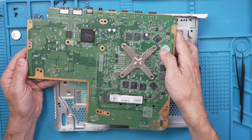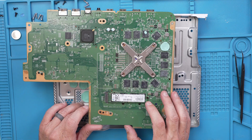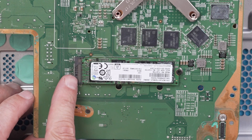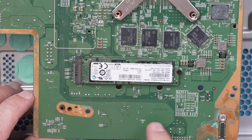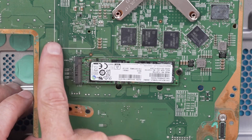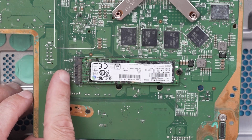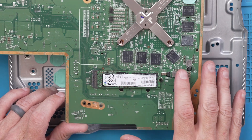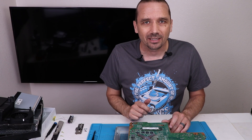We do have one SSD on here. If you ever look at the motherboard of a retail Xbox One X, you'll see the slot for the M2 SSD drive but it's just not populated — it doesn't have the connectors or all these little capacitors. So what's interesting is they probably just used this on the developer version and then left all the circuitry there. I've seen a lot of people wonder if we could populate this connector on the retail version, and I've thought about doing a video on that — if you want to see that, leave a comment and maybe we can do it in a future video.